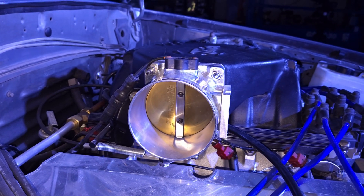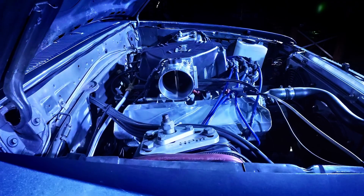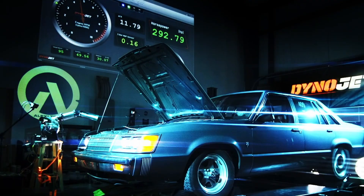The internal diameter of the outlet of the volute is 2.3 inches, or just under 59 millimeters. That's surprisingly small, but remember, this is a compressor. From there, the air goes up to the AccuFab throttle body, which is 100 millimeters, and we know that's not really much of a restriction on this engine.